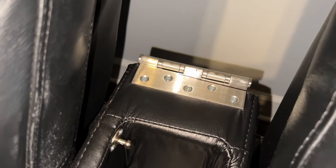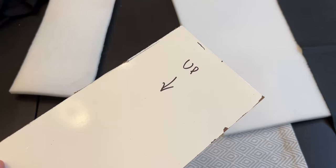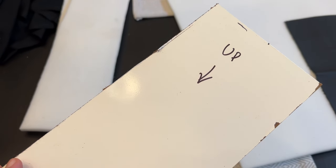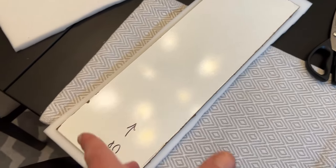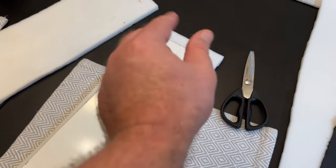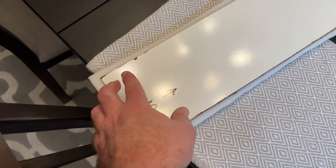Take the bracket back off the seat and you'll be able to put it on the new armrest since the measurements are relative. I marked which side is up and down and which way is forward. For your foam pieces, cut them so you've got about a half-inch overlay on the sides and about one inch on the shorter sides. This will help with that gap in the front. We're going to put our hinge on last.